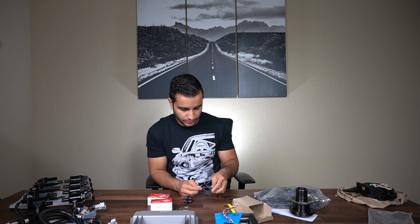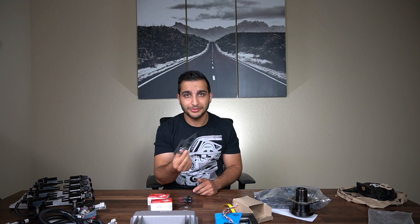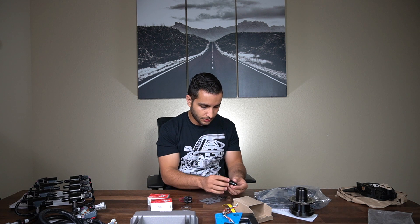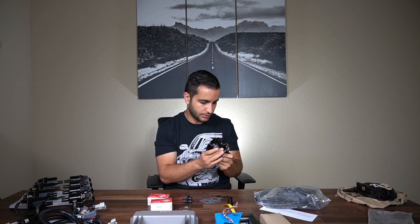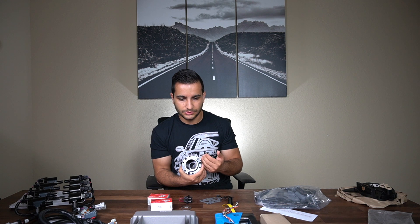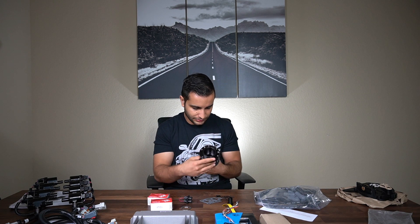What I really like about this kit is it also comes with hardware — like water pump gaskets — because you're going to have to take the water pump out to get to your OptiSpark, which is the worst thing you can have. But the gaskets come with the kit, so that's very helpful. It comes with a bunch of different accessories and hardware that I won't get into today, because the installation phase is really when we'll start realizing what connects with what and how all these hardware pieces work together. You've got your hub here — this adapter will help you run this setup with your traditional LT1 belt and LT1 setup. They're really after making this as user-friendly and as easy to install as if it were OEM. Overall finish looks really good.